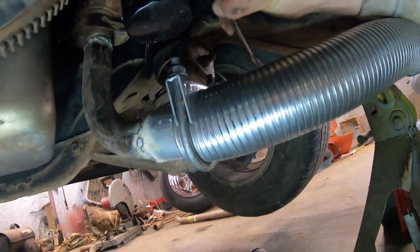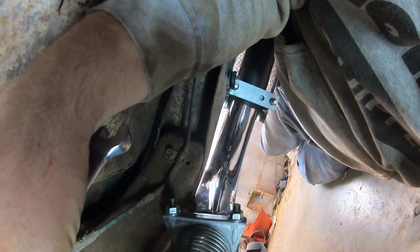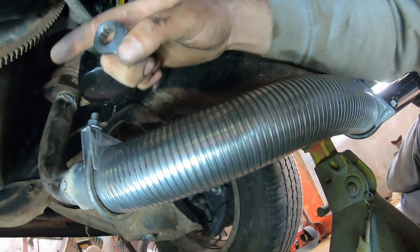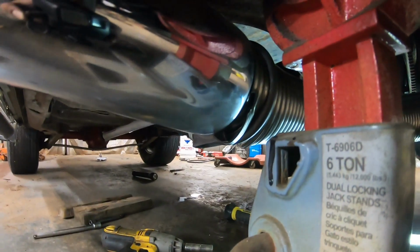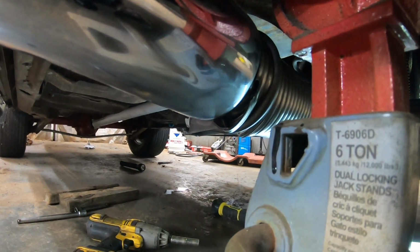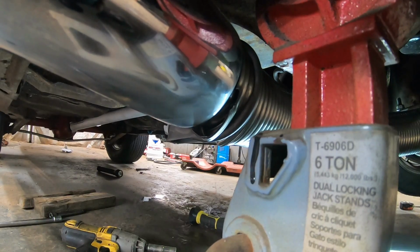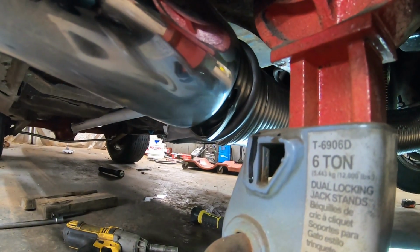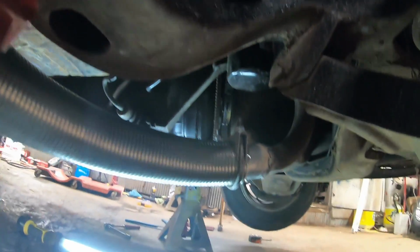When you put your muffler clamps on, always point the bolts up or sideways. Don't let them hang down. That just looks trashy. Well, in hindsight, maybe the flex pipe wasn't the best idea, especially considering I probably could have made a regular 45 work. But, live and learn, $8. It's worth a shot, and I'd really still rather have somebody make that better anyway down the road.